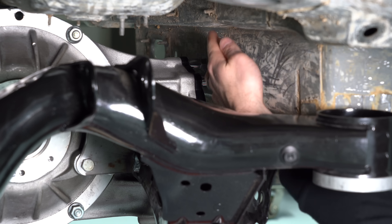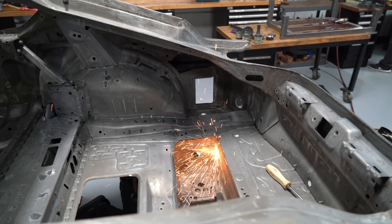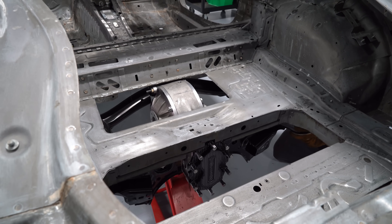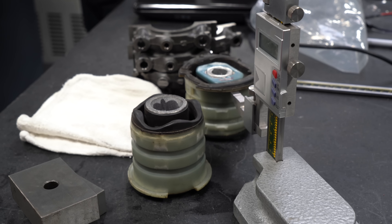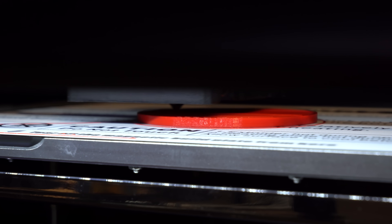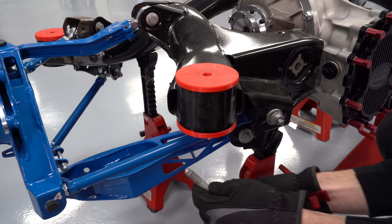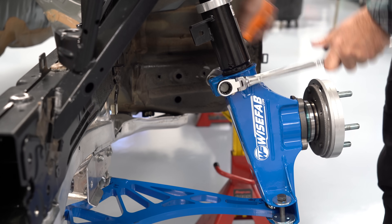There were several parts of the car we had to notch to fit the quick change, so we started cutting open the chassis. The whole box in the rear that we're taking out is where the battery was originally located. The factory bushing is a one-piece pressed deal with rubber isolators — great for street driving and comfort, but we're willing to compromise all the comfort for performance. After measuring all the factory rubber bushings, I designed solid bushings and printed them on our 3D printer. I made this one a two-piece: a top and bottom that press in, and a single stock screw holds the whole subframe back up.